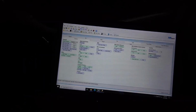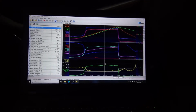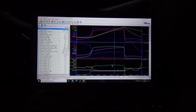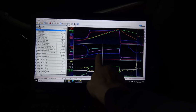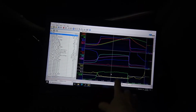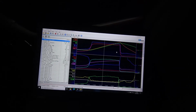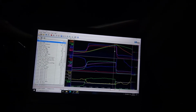I had to trim the air fuels a little richer, just another percent on the top. I just flashed that file in, so you can see here's where I was just at with that dyno graph. And you can see I was a little lean. Pretty good in the mid-range. I was a little lean down here. You see I picked up a little knock, so I actually took a little timing out here. I added some fuel here, and I added some fuel up here. So you can see at the top there, 199 kPa. So yeah, we're over 14 PSI here at the top.